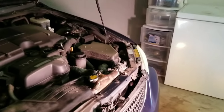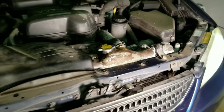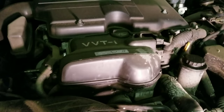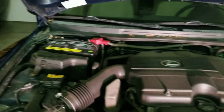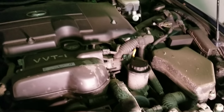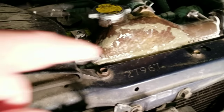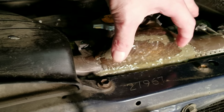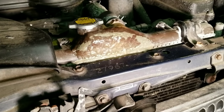They built the car with a plastic radiator. And if you look here — it's a VVTI V6 — it's got a new battery, really well taken care of. You can see it's a little dirty underneath. We had a little bit of a mishap here: the radiator cracked. What happened is it cracked along here, about a crack about this long, and I did some research and I wanted to share my results.